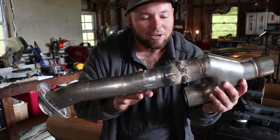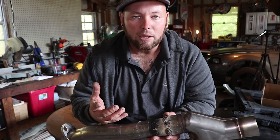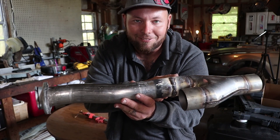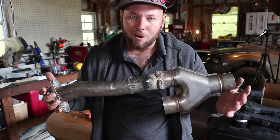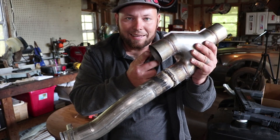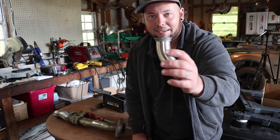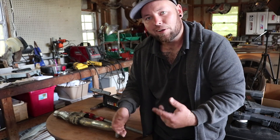This pipe started melting because one section is a little thicker - I had to build up material on one side and add material on the other. Sometimes it would burn a hole and I'd just rotate the pipe to the other side to keep the temperature down, while keeping the pipe warm enough to weld without burning through. All this is gonna get exhaust wrapped. I'm gonna go under the car and see how this fits up and keep doing mock-up. The hot side is coming from the x-pipe and this pipe will need more bends - I'll have to make the bends for the inlet.